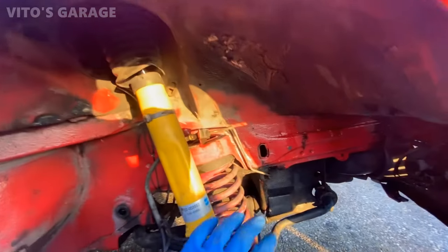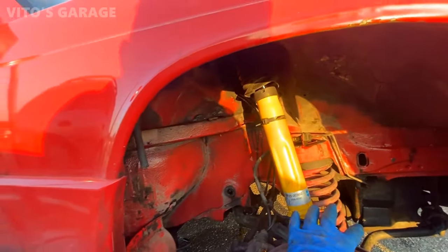My fender liner is all drying up after I washed it. Now, if you see a rusty spot under your car, you actually have to wire wheel the rust off first to bare metal, put three coats of primer on it and wait about five minutes between each coat, then coat it with a base coat. After that, let it dry, and then you're ready to apply either wheel bearing grease or fluid film. If you're working on your undercarriage and you see rusty spots, you have to wire wheel those first and treat the rust with paint. It's really important to wire wheel it off first — when people say just put miracle paint on top of the rust, you're not treating the rust, you're just putting a band-aid on it. That's all you're doing.